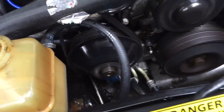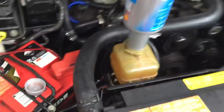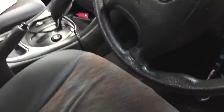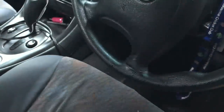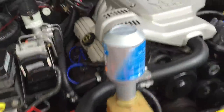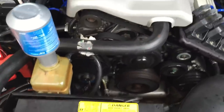It's used quite a bit so I'm going to have to get some more. Now while it's running, make sure you turn the steering wheel left and right a few times so the fluid gets in there all over the place. Then take it for a decent drive and it should be all good.